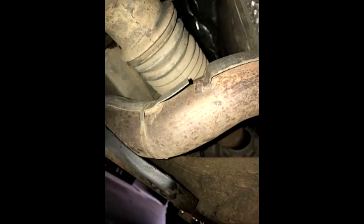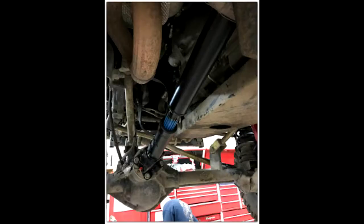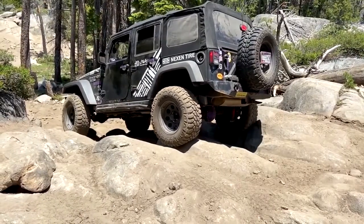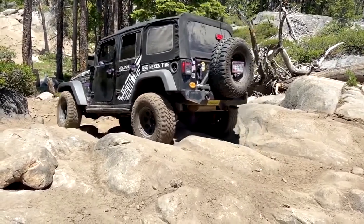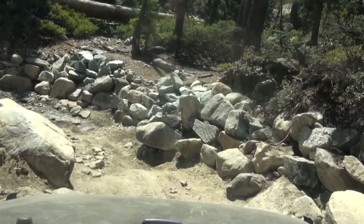You're going to see this issue with three inches or more of lift, even after 20 to 30k miles on or off-road driving. The Tom Woods driveshaft has a smaller diameter, which allows the suspension to drop without touching the exhaust. Don't get caught off guard with a clunk or a snap after you've put that new shiny lift and tires on. Consider upgrading your driveshafts.